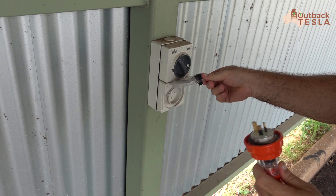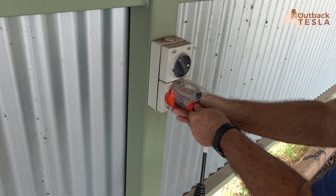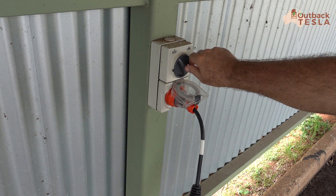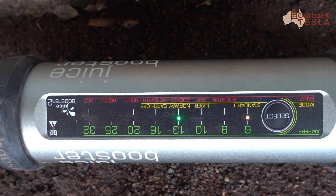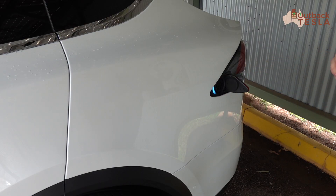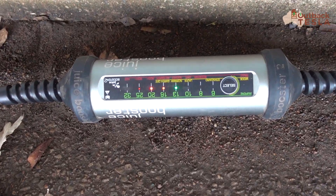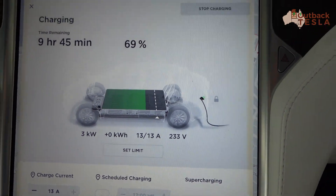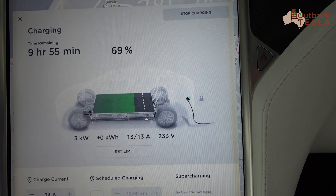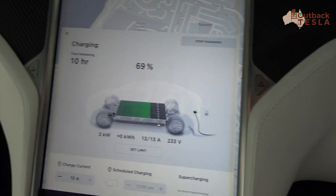Here we are at the 15 amp plug — we just plug in there. These are threaded plugs, so you screw the plug in to hold it and turn on the power. You'll see all of the LEDs light up first — auto detection picks up 13 amps, which is probably right, and the car is now ready to charge. We plug the Type 2 connection into the back of the Model X: green means charging, and the Juice Booster LEDs show sequence charging as well. Inside the car, no manual settings required — the car picked that up from the Juice Booster and we're seeing 13 amps. These 13–15 amp charges aren't something you want to rely on all the time, but they're good for an overnight or emergency charge.